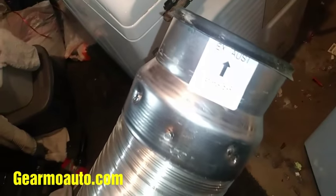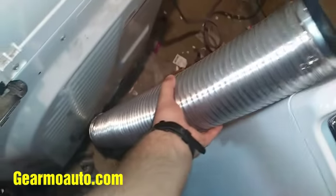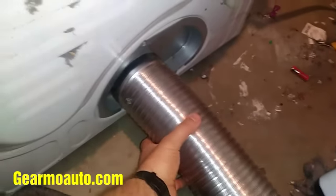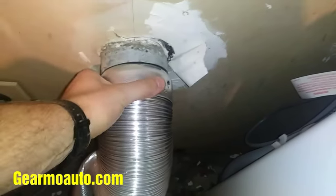This side says 'exhaust' and this side says nothing. I noticed that this side is smaller than the other side, so I decided to put the smaller end at the dryer. Where it says 'exhaust' I'm going to put that to the wall. This part just actually fits in that hole and the rubber holds it in place — you'll have to get the dryer closer to the wall. I just stuck it in there and it's pretty firm on both the wall and the dryer.